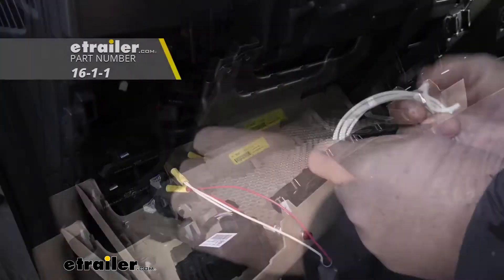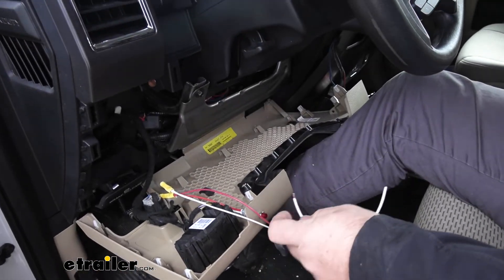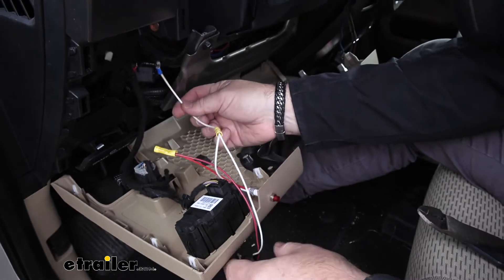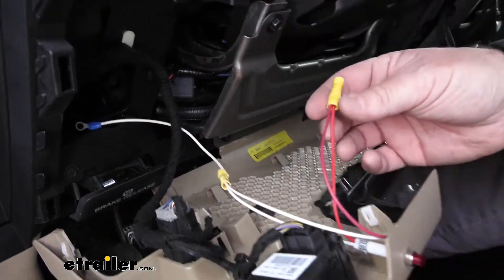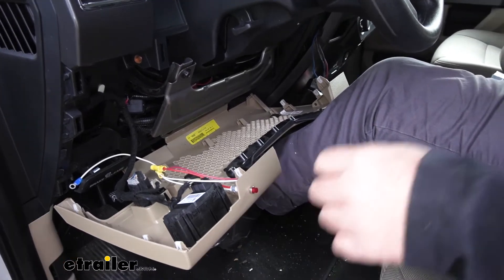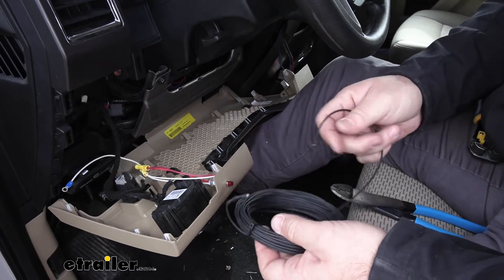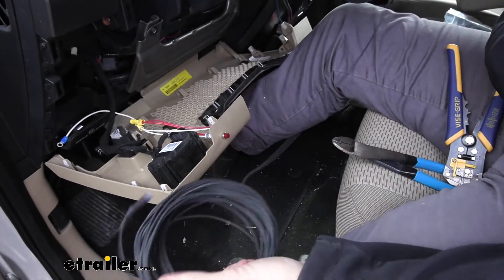I think I'm just going to ground it right in here. I'm probably only going to use maybe six inches — strip back both sides, ring terminal on one end, and add the other end to the butt connector. Make sure it's got a good hold. Now what we need to do is extend our red wires all the way across to our blue wire. Your kit comes with a bundle of black wire that you would normally run to the back if you didn't have a signal — this is what we're going to use to extend our wire. You can actually use this to extend the white wire too if you wanted; I like to keep mine color-matched, but you're not going to see any of it, so it's completely up to you.